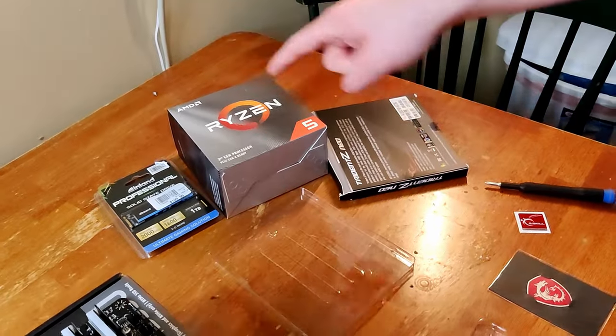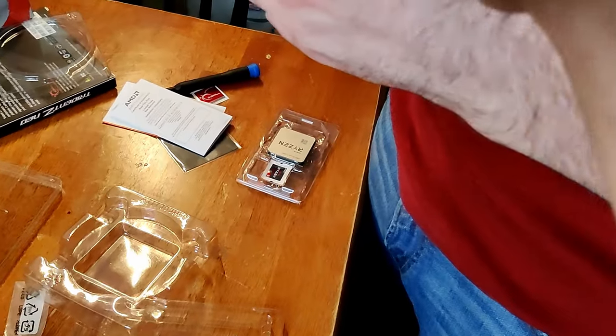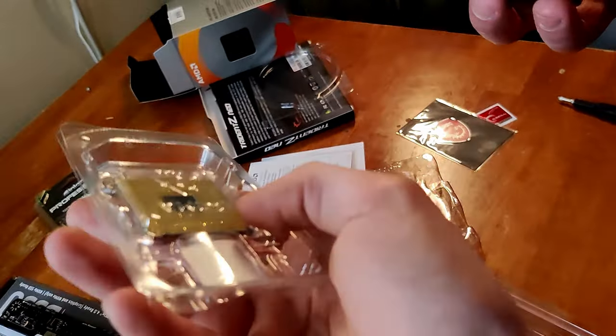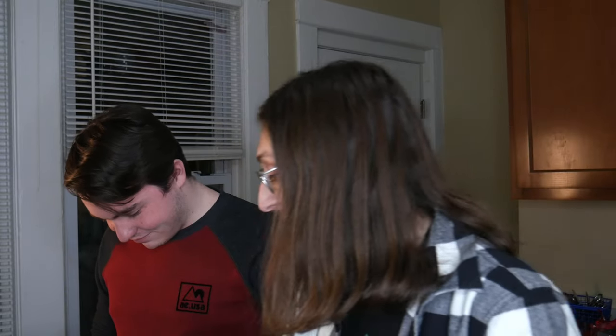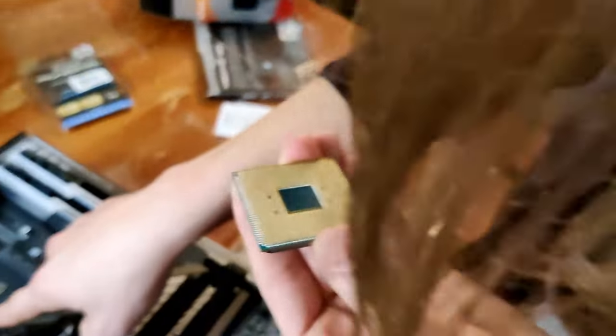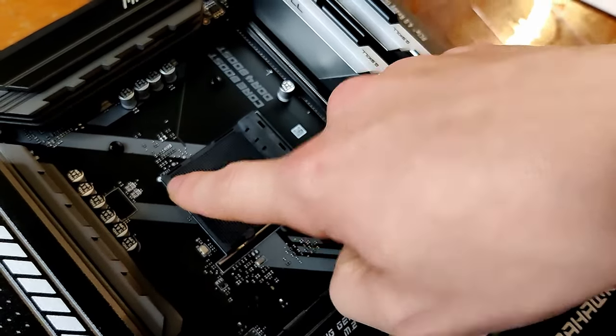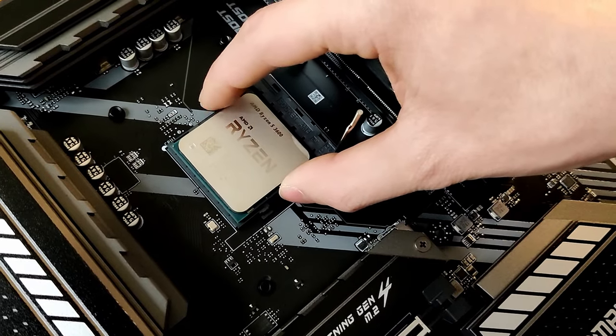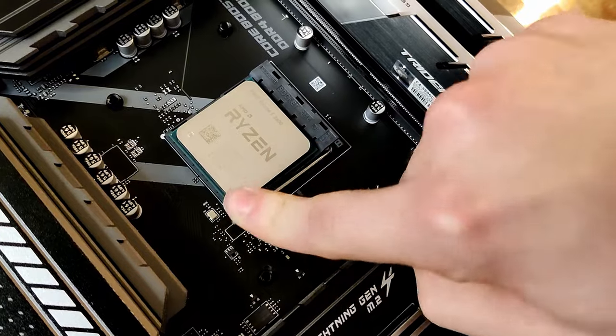Can we do a freeze frame? So what are you going to do now — do you want to do your SSD or do you want to do your CPU? I want to do the CPU. Oh boy. And you can see that big square right there? That's thermal paste. You touch it, you die. Now it is time for easily one of the scariest parts of CPU installation. Look at all those little teeny tiny pins. They're very delicate and bend very easily. Typically when you're installing a CPU, you hold it by the edges, because you can bend one of those tiny pins and ruin your CPU. There's a triangle on one of the corners of the socket, which is usually up here for AMD motherboard. You push this little arm thing down, pull it out, and lift it up like that — put it in that way. Get a little wiggle so it's in all the holes. Put it down. CPU is installed!